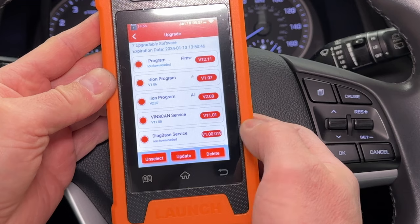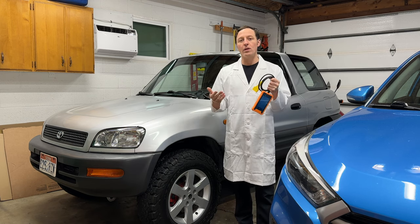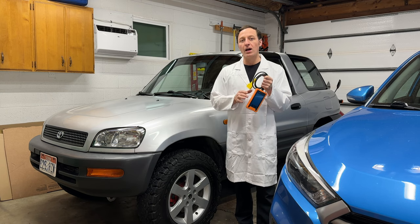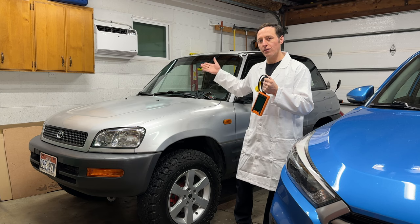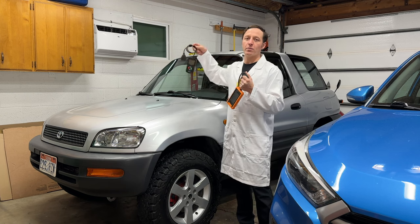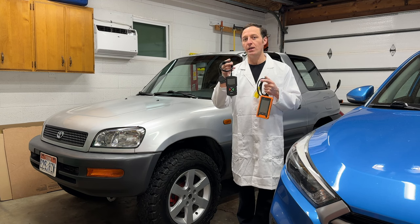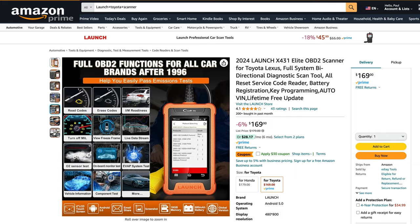There's also a button on the screen for upgrading software and updating the tool — you'll need Wi-Fi to do that. My final thoughts: it works really well on newer Toyota vehicles. If you own a newer Toyota or Lexus and you do your own car work, you can save a lot of money by scanning your own engine codes, ABS, TPMS, and airbag systems. For the older 1997 RAV4, I found this tool is actually very slow and spends a lot of time on loading screens — I actually prefer the basic YA-201 tool for that car. You can find this scan tool on Amazon; it's called the Launch X431. They have all-systems versions available for Toyota and Honda vehicles with the option to upgrade software to add other brands. Follow the link in the video description if you want to buy this scan tool. Thanks for watching, and I'll see you next time.